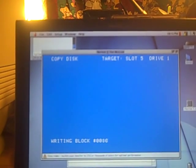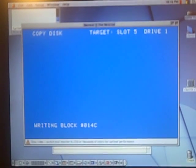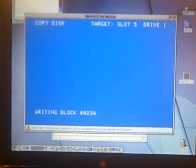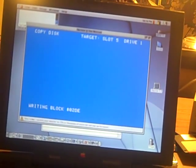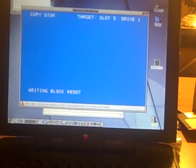It's going to read and simultaneously write to the disk. Seems to be working. I was having some difficulties initially because my floppy drive was failing. Luckily I have three floppy drives for the G3 Kanga. But if you do not have a PowerPC machine running OS 8 or 9, there are other ways to make these disks using the OS 10 emulator, and there's supposedly a way to do it using a Windows machine. It took me about four hours to figure this out, and then a light bulb went off — why don't I try using a real, bona fide PowerPC? And it worked.